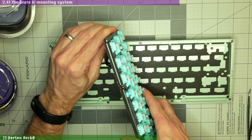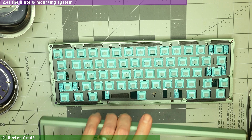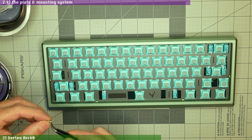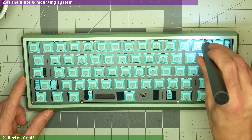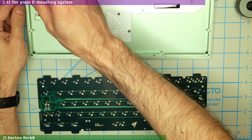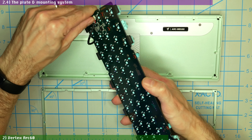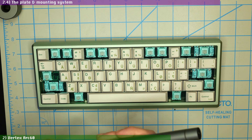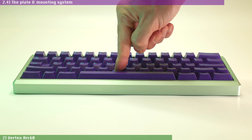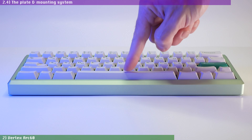When using the HotSwap PCB plus plate configuration, you simply place the assembly on top of the bottom half of the case, matching the plate winglets to their respective grooves on the mounting adapter ring, and then sandwich it with the top half and screw the two halves together with eight screws. If you decide to go with the soldered plateless build, you'll have to remove the seven screws attaching the mounting adapter ring to the bottom case, place the PCB with its gaskets into their respective grooves, then flip the mounting adapter ring and screw it to the top half of the case.